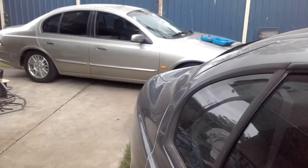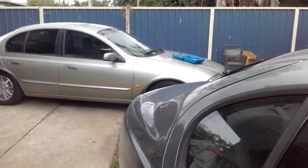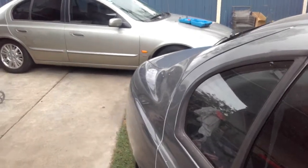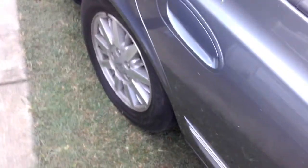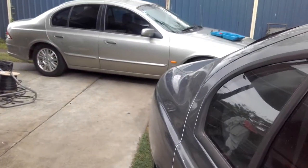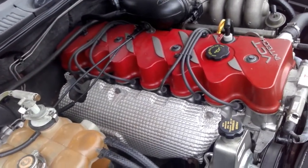There's a little bit of water there, a bit of vapor — you shouldn't have any vapor coming out of the back of that exhaust. That tells me we certainly do have a leak somewhere. Now we've got to find it. It's time to take out the spark plugs and have a look for any telltales in the cylinders.